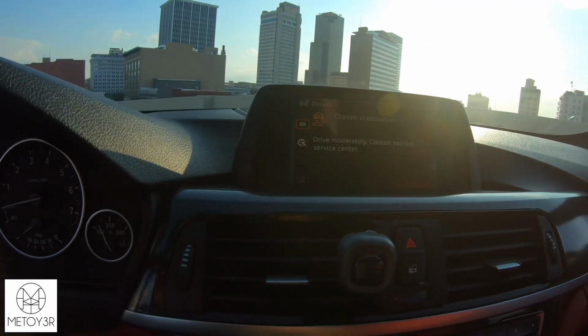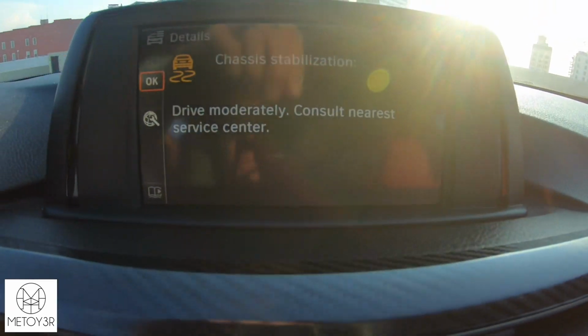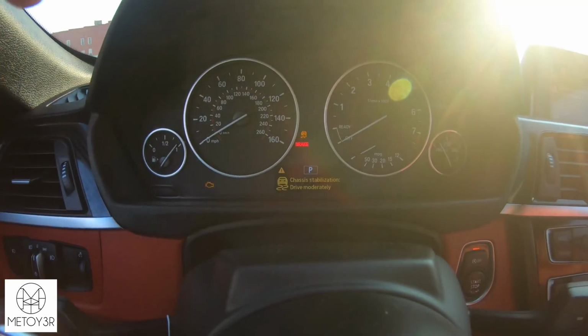Just like what I told you guys earlier, make sure you're turning everything off to conserve battery if you're not hooked up to a charger. Once you do that, go ahead and hit flash. It'll say please wait. Now mind you, my screen will probably go a little faster just because I've already flashed my car, but for you guys that are flashing for the first time, it is going to take about 3 to 5 minutes to completely flash. So your numbers will go up a little slower, but for those of you that have already flashed your car, it won't take too long. Now when you flash your vehicle, you will see a whole bunch of warnings come up. I don't know if you guys can see that, and then you'll see it on here as well.